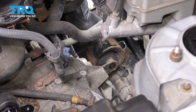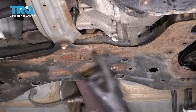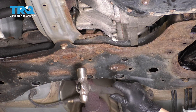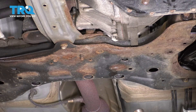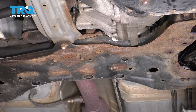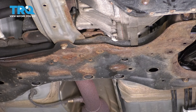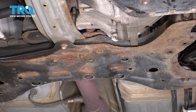Now let's lift up on this engine mount. The engine mount is actually seized in here — either this stud or a combination of studs are just stuck inside the subframe and it won't break free. So I'm going to take a hammer and try to hammer it up. You can see the engine mount right here so we can watch it break free when it does. I'm pretty sure the rear is broken free because I can feel a little movement, but the front feels like it's bolted on — it's just that it's seized in the subframe. There we go, that just popped free. It was that stud. Let's double check these — yep, that's free. Let's go back up top and remove the mount. Now with it broken free, we can raise it up.